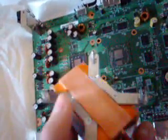You can just use a Brillo pad and some hot soapy water and get all the thermal paste off it, like this one as well. And do the same with them too, until you can see your face in them, or you can see the reflection in them. And then for them I used cotton buds, some tissue and nail varnish remover, and that made them clean.